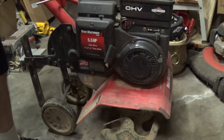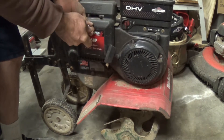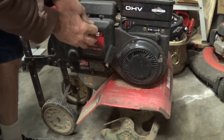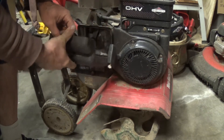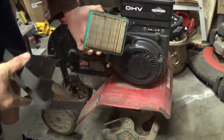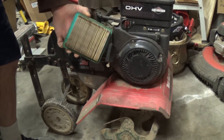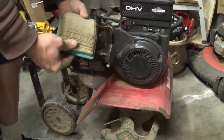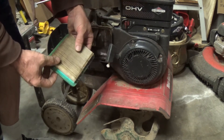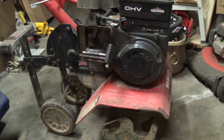I'm just going through and cleaning the tines off here. I'm opening it up and looking at the air filter. This one obviously needs to be replaced, but it wasn't completely stopped up — I've gotten most of the dust and debris out of it, it's just old. So I'm going to use it this time, but I will get another one. That's what I do at the end: go through everything and look for what I need to replace, so I can do that over the next year while I'm waiting to use it again.